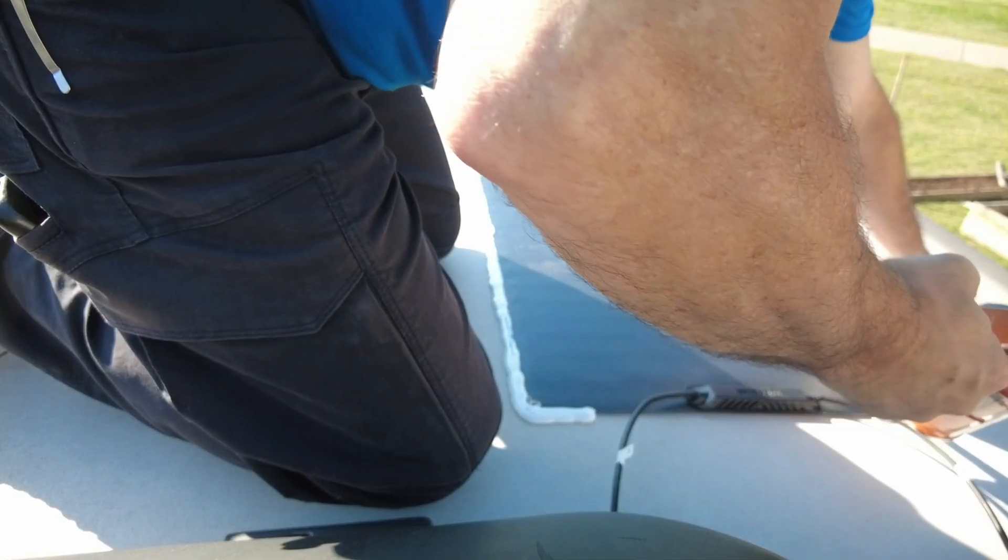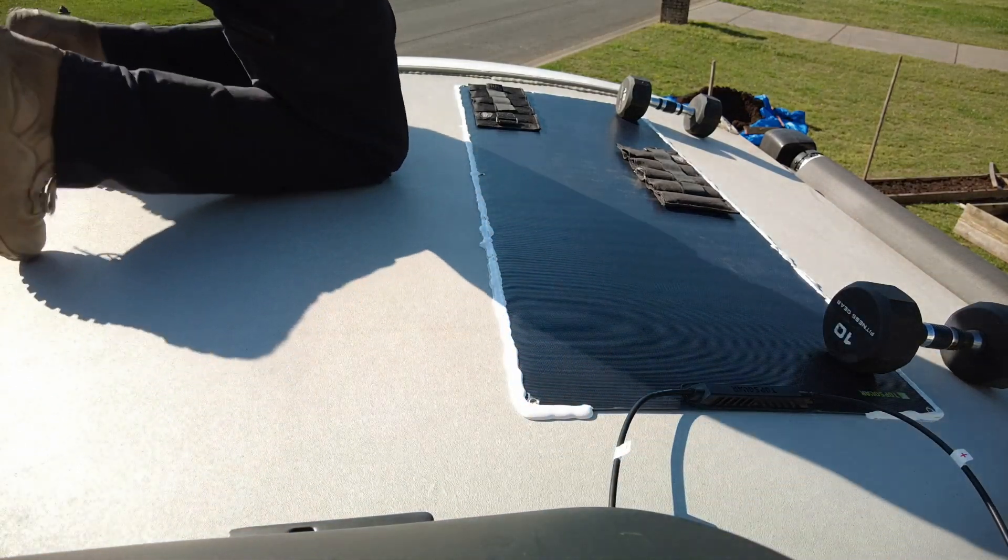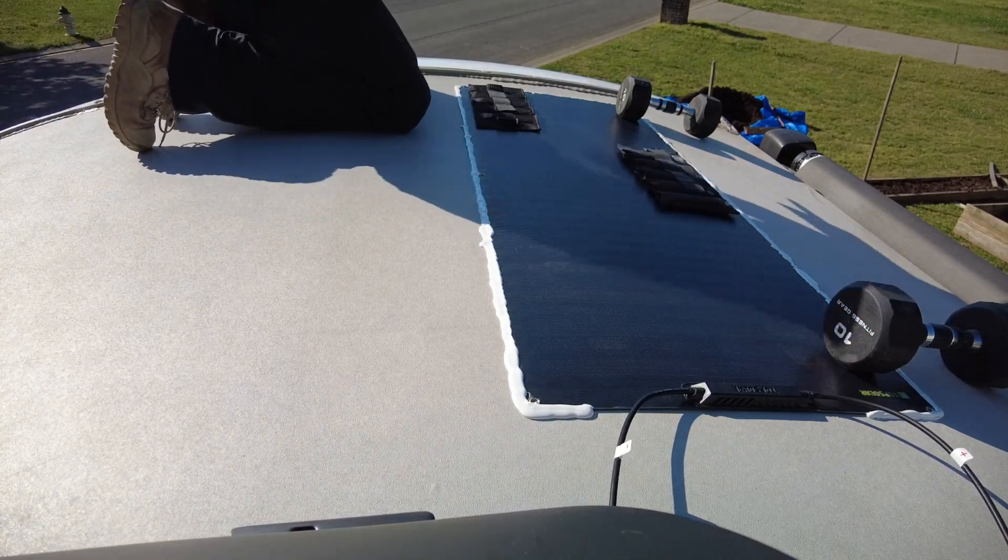I went around about 90% of my panel with this roof sealant. On the back side — the downwind side of the installation — I did leave about an 8-inch strip with no caulk on it. The purpose of that, which I did the same on the first panel I mounted this way, is to allow any water that gets under that panel to evaporate out from underneath it. The last thing you want is water trapped between a solar panel and the roof of your RV, and this goes for condensation as well. So I left that 8-inch section free of roof sealant to give that water a way to escape.